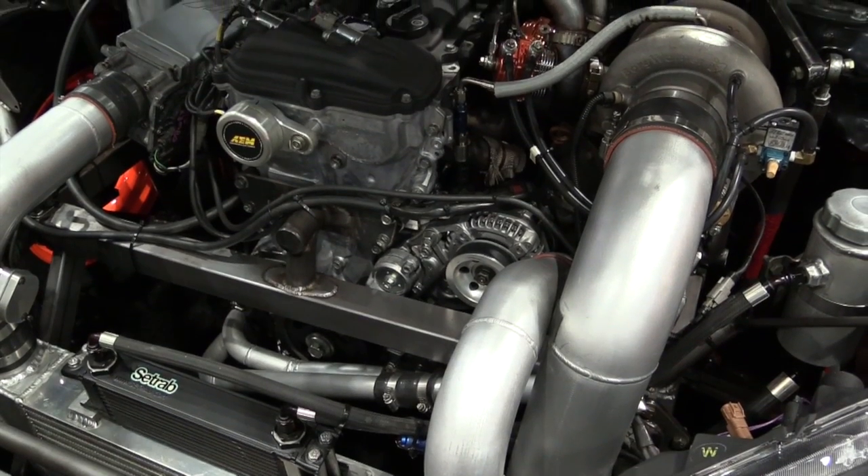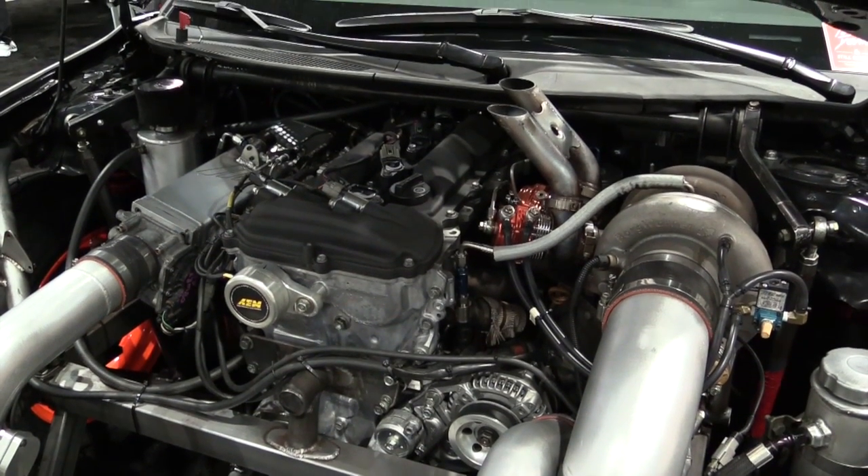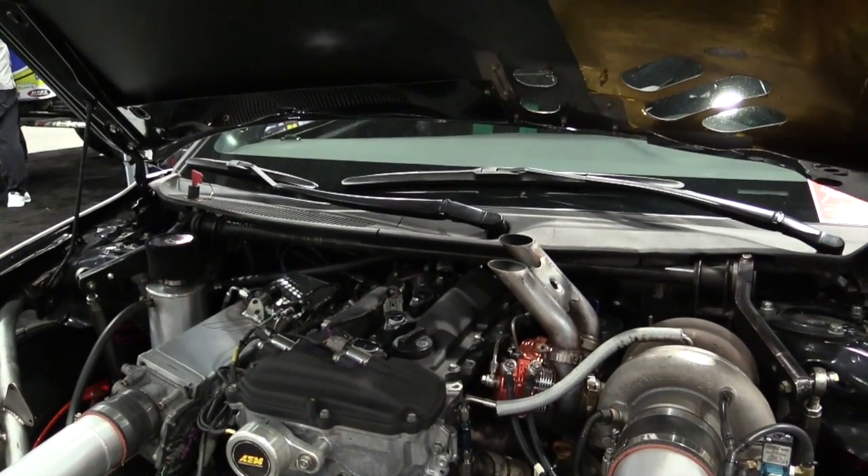That engine — you said you're making somewhere around 700 to 800 horsepower, running a large turbo and a shot of nitrous. What did you have to do to keep it reliable at that power level? The 2AR engine is actually quite strong from the factory on the bottom end. We use the 2.7 liter crank out of a 1AR, reground for a traditional 2-inch rod bearing. We use a forged rod, a JE piston, and actually a stock sleeve.